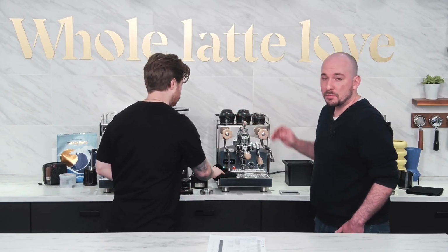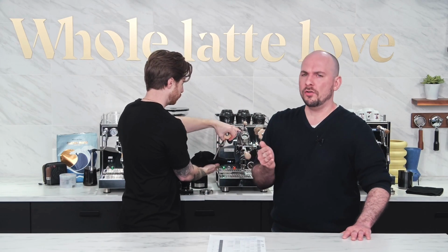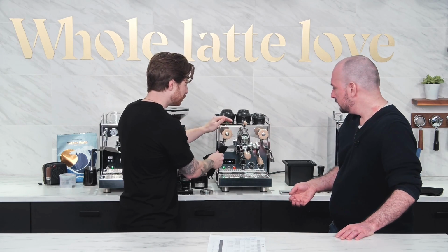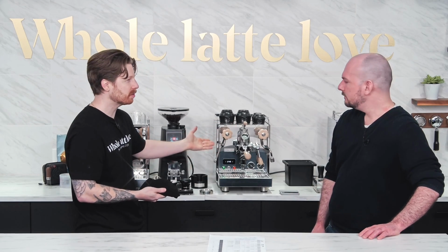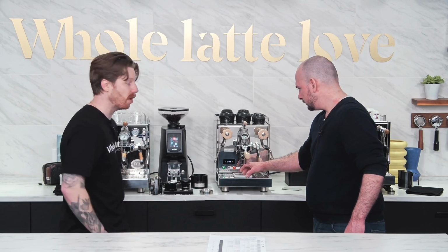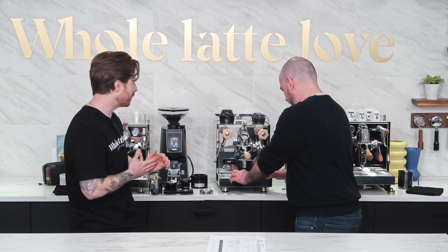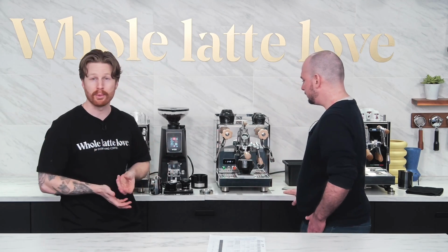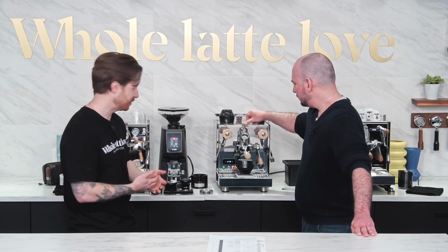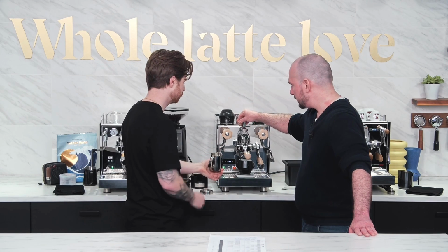There's a spring inside that's providing tension, and that's actually sealing that valve so that you don't have to twist it and crank it all the way closed, which can strip that. And what's really great about these sorts of valves, especially if you start getting into latte art, sometimes this is a little bit more preferable too than the quicks, just because I have so much control on my steam pressure. Now, this is a very particular sort of thing. I just do like these kinds of valves. It might be more of a personal preference because those quick actions that you'll see on other machines are super nice. And so for our flow control, we want to go 1 1/2 turns for a vibratory pump to get to stock flow rate.